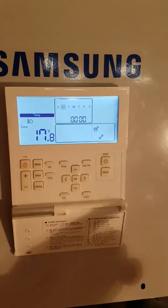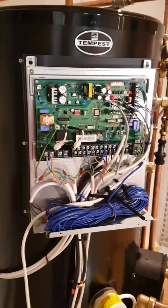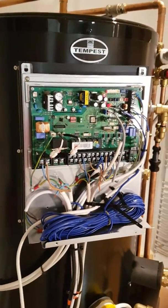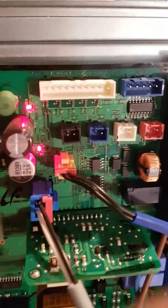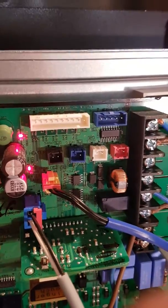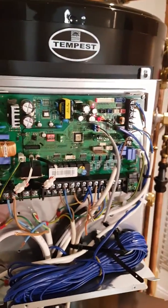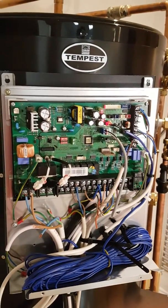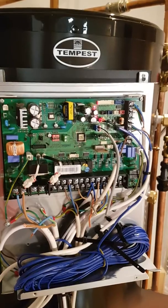In this video I'm going to explain fault code E121. If you look inside the unit very closely at these plugs here — the little black one, the blue one, the white one, and the red one — they can have additional sensors which we don't normally use. But if somebody has told the unit these sensors are in place, you get error E121. I'll show you how to solve it.